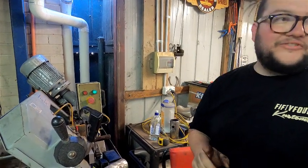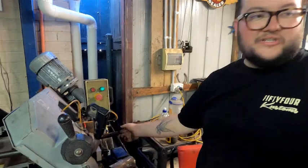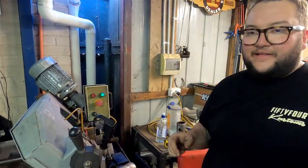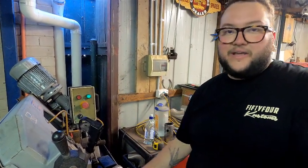Diff down, it looks really short, but we know it's right from our measurements. What we're doing now is just cutting the same amount out of the axles as we cut out of the diff, put it all back together, slide it under the car, put the wheels on it, and just check that our width was correct. But it's a bit late now if it's not.